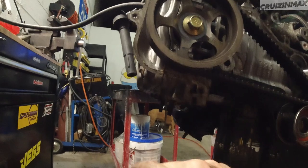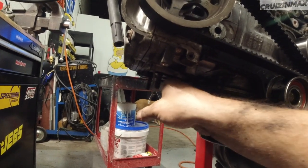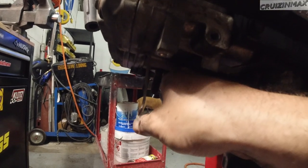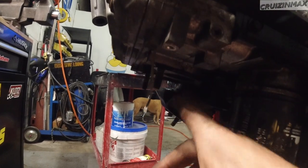Air going into the cylinder via the spark plug, and you hear that? Coming off of the exhaust port on number one, which means the exhaust valve had it. That's it. We're gonna tear this down, assess the situation.